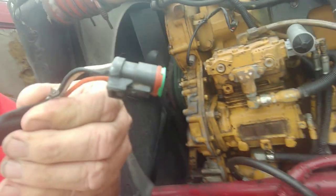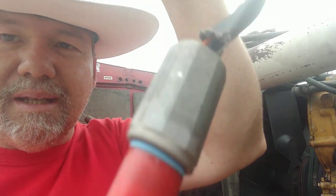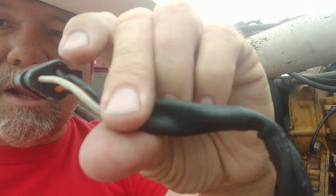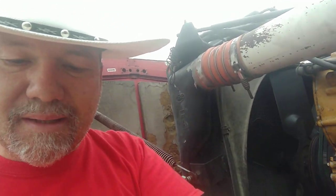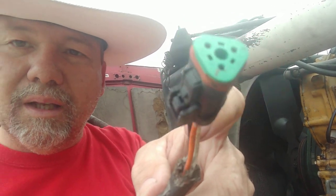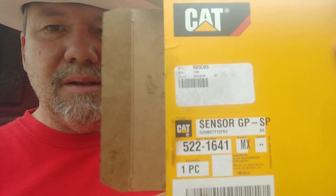Now the problem with this one isn't apparent — you can't tell just by looking, but it's there. It's not at the business end; it's at the plug end. And if I remember correctly, it was this black wire right here — there's something going on inside here, not making a solid connection. We can't find a break anywhere in the line, but you can mess with that little dude while it's running and the truck will try to die — it's like a bucking bronco.